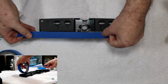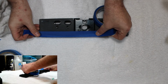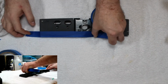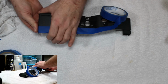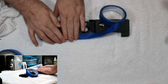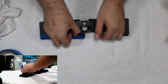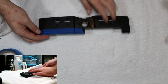And we're going to tape over the top part, and we're going to push all the way up to the edge across the crack. And you'll see why I'm doing this here in a minute. I don't want any part of the crack visible. I want it to look like I've basically taped over to the next section of plastic across the crack. What we're going to do is wind up pushing that tape down. It's going to fold up underneath the crack, and it is going to allow for a much cleaner, nicer peel once it's done. And it'll be a much cleaner paint line.